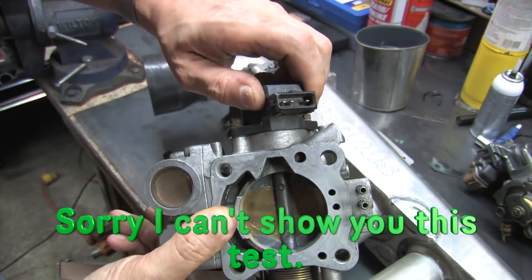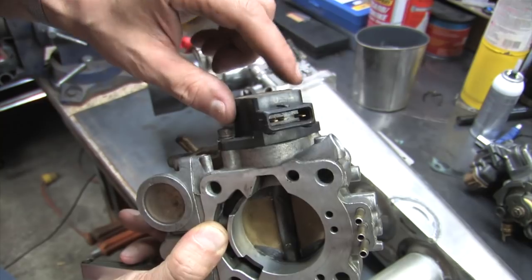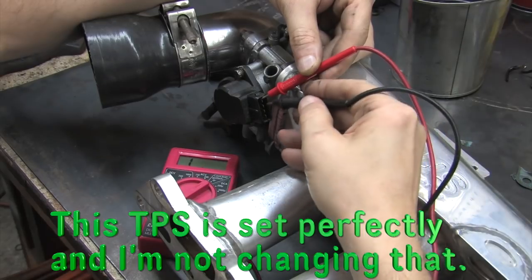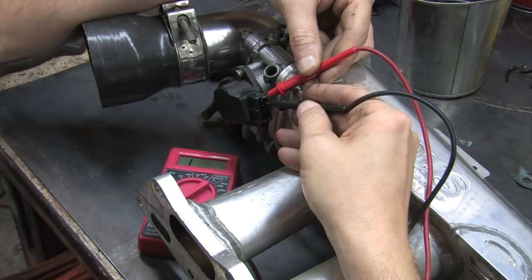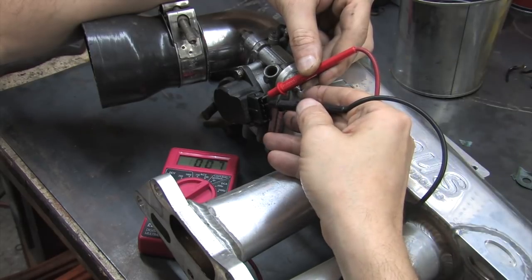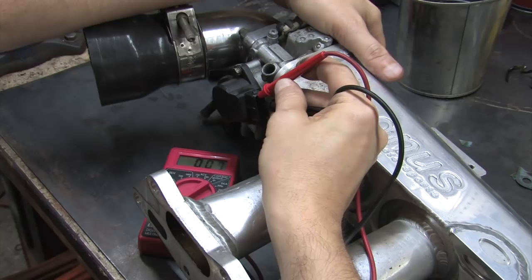I've got the wrong TPS sensor here. This is a 1G and it doesn't have an idle switch built into it. But anyway, you test for continuity across pins 3 and 4 if you have them, turn the TPS counterclockwise, and then slowly back until the point where you lose continuity on your meter. Snug down the bolts. Basically, you set up the idle switch position by using a feeler gauge, and the ECU has to just deal with the rest.